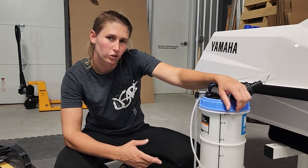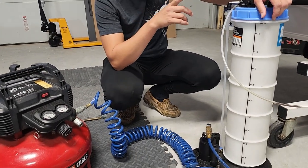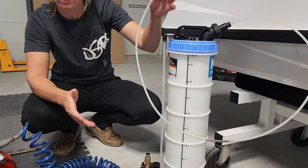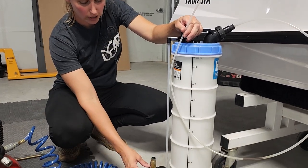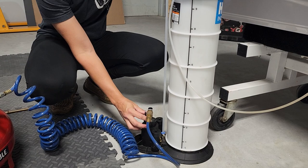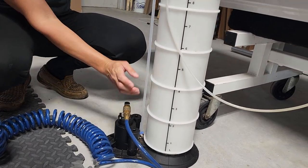Your refill point is going to be up here where you're going to put your funnel. With this pneumatic oil extractor, we've hooked up the air compressor, and once we're ready to extract the oil, we've got to make sure that wherever we put this it's going to be clean so it doesn't introduce any contaminants to the engine. Then once we're ready to go, I'm going to turn on that valve there and it's going to extract the oil into this reservoir.